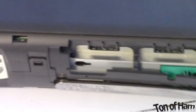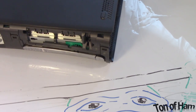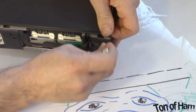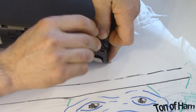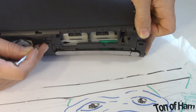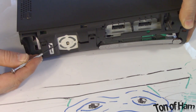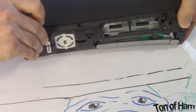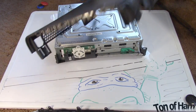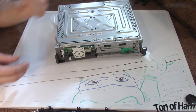Once that happens, flip it back open and turn it around. We'll start on this side closest to the DVD drive. Use a little pry screwdriver to pop that one on the end out and lift up on it so it pops free. You may have to tear your Microsoft sticker — this will void the warranty, but I think it's a little late for that. So let's just lift the whole top off, exposing yet more pieces.